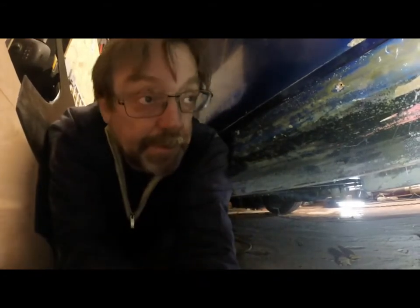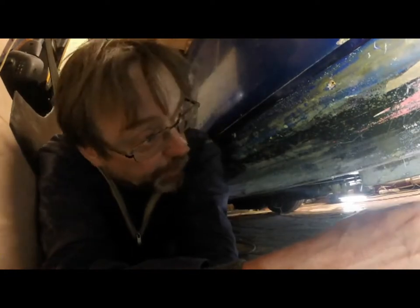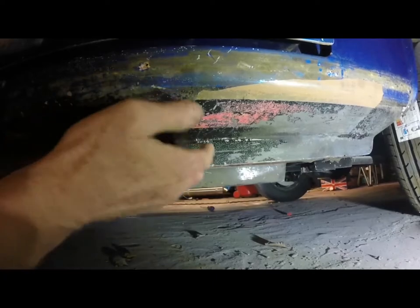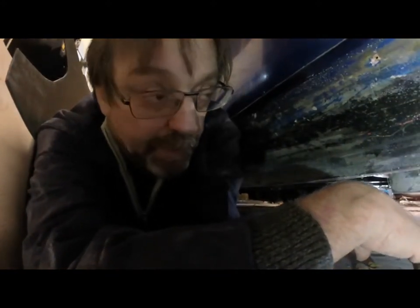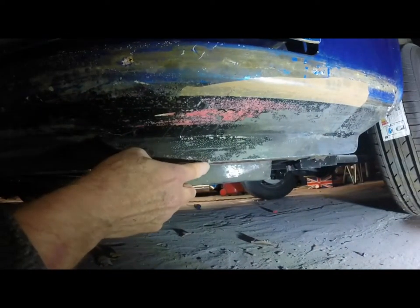Oh yeah, here's a piece still left, and that's the brown sort. And then I sprayed it with spray grease. I think it's designed for motorcycle chains or something. And so then, having done that, I just laid fiberglass over the top of it, resin, matting, the whole thing, and laminating upwards, clearly wasn't the easiest thing to do, because it has a tendency to fall down again. And in fact, underneath, it was virtually impossible, which is why, if you've noticed, there's actually a piece of black quadrant underneath the mould where I couldn't get fiberglass to go around the corner.